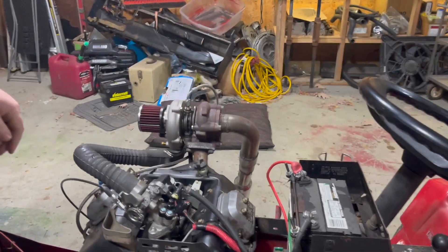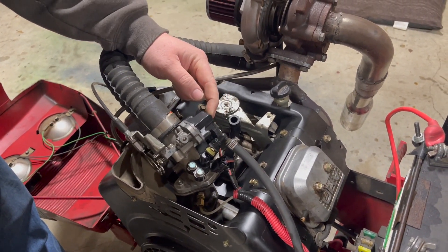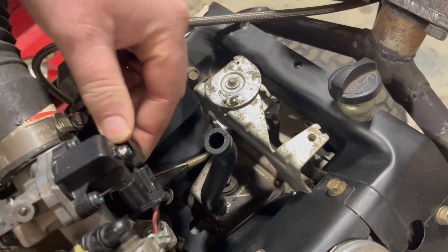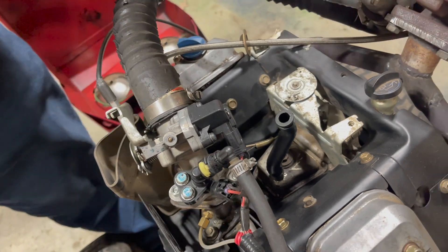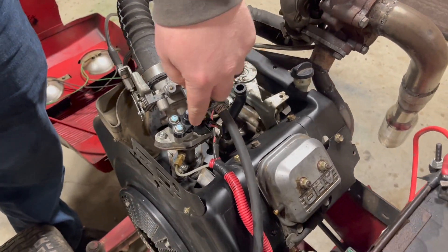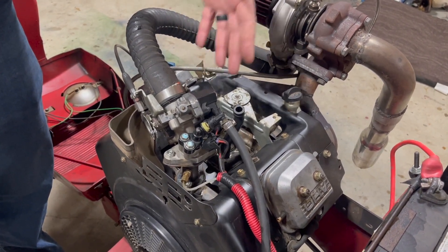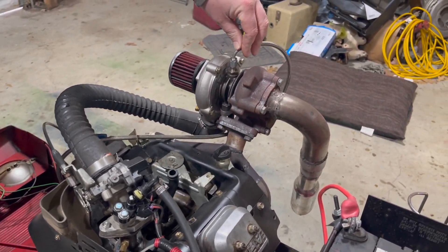Let's come up here to the throttle body and explain what's going on. We've got the injector tied into the fuel system. There's an idle air control valve which is currently not being used — I just tweak idle with the idle set screw. One of the key sensors is the throttle position sensor on the side of the throttle body. The Arduino ECU reads throttle position from that sensor and controls the pulse rate of the injector based on a calculation of where the throttle position is, calculates engine RPM from that, and fires the injector accordingly.